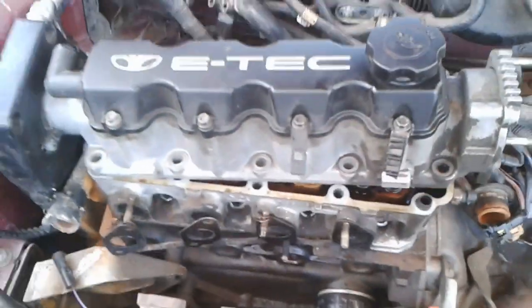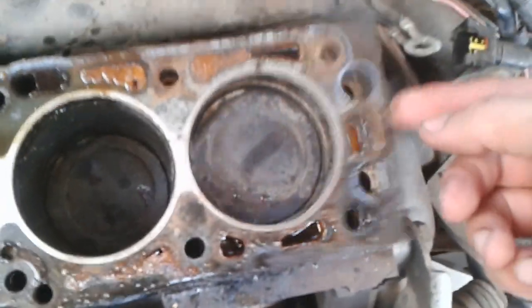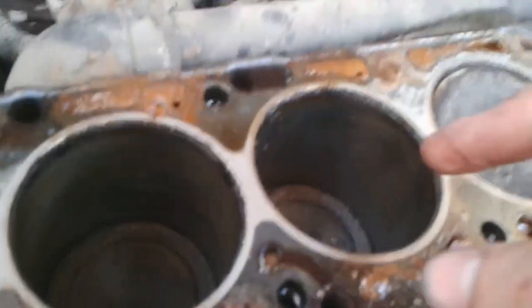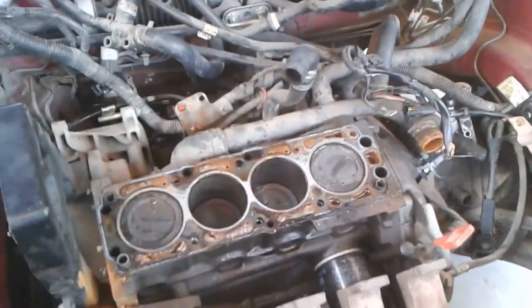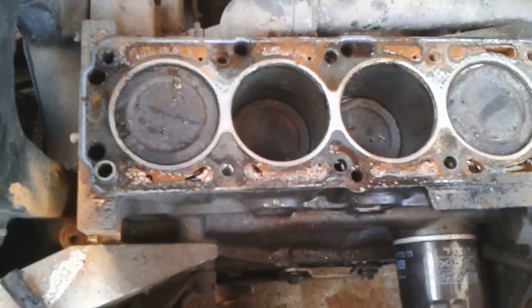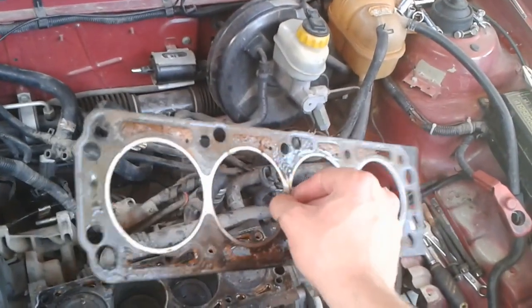Now I'm off with the head - the plot thickens. Look at that: the head gasket doesn't look factory. I'm quite sure this was an aftermarket head gasket. And if you look at the cylinder walls, they look cross-hatched, which makes me think there was some sort of work done on the cylinders, perhaps for changing the piston rings. This gives me the feel that the performance of this engine will be better than the other one, despite the head gasket being blown. I can't believe how nasty this head gasket is - definitely aftermarket.